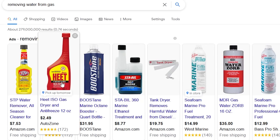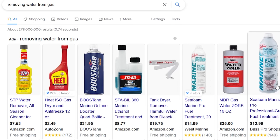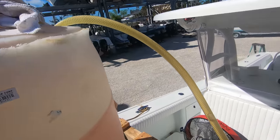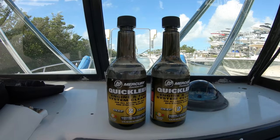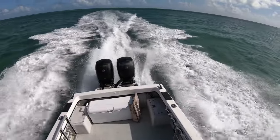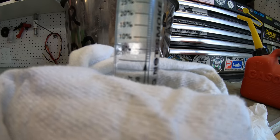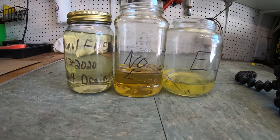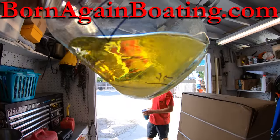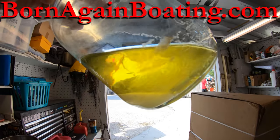This way you can treat the fuel with whatever treatment you like and burn that all up in one shot. Don't let the boat sit for another month or two like this — go burn all that out immediately. Then fill up with some non-ethanol fuel and treat it with some Ring Free or some Quick Clean, running some of that fuel through the engine to clean out the fuel pumps and the injectors, hopefully resolving your issue. Now hopefully you know a little more about ethanol blended fuel for your boat — we'd love to hear about any experience you've had with bad fuel and what you did. Let us know in the comments section below and over on the Born Again Boating community at bornagainboating.com. Don't forget to subscribe to the channel. Thank you all for hanging out with us this week and we look forward to seeing you next week.